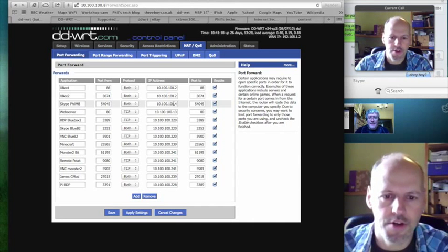So you've allocated those IP addresses for the Xbox. Yeah, that's right. I know that Xbox is always .2 on my network. Skype, you know, that's that trick of port forwarding for Skype to make sure that you never go via a super node, so that your Skype quality is always maintained. That's another thing that's worth doing.